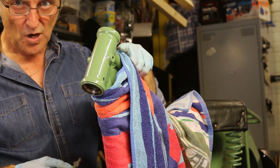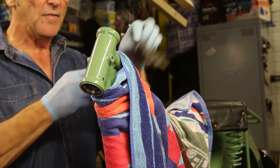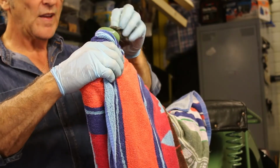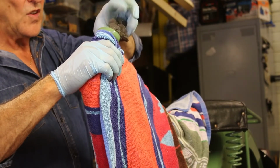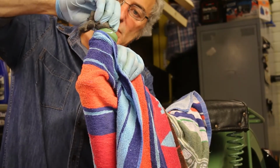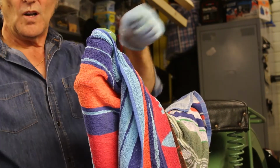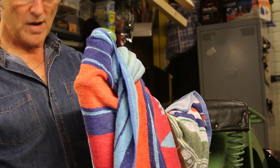And likewise on the top, just getting a bit of wire wool, making sure that where the ball bearings sit, where the paint spray, and I'm putting this round to protect the paint while I grab hold of it, just making sure that it's all nice and clean and tidy, and there's nothing that's going to cause any undue wear on the ball bearings, so that when we come to put them on, everything's as clean as it can possibly be. Because the last thing we want really is for there to be notches, or when you're doing the steering, something causing it to not be quite right. I know Bantams don't go fast, but at least you want it to be safe.